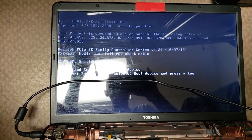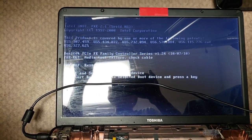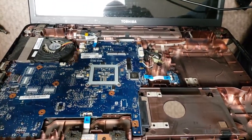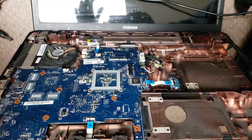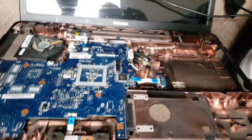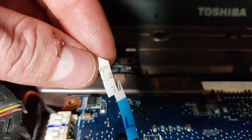Now turn it off. Plug in one by one each component and boot it back up. Plug components in one by one, booting it up every time. If it boots up great, that component's fine. Obviously you want to make sure any liquid damage is cleaned off.